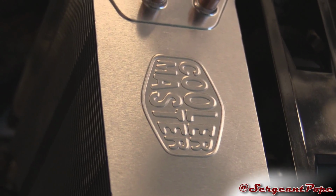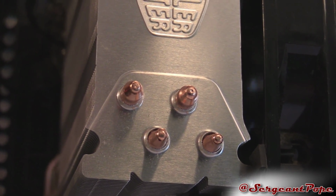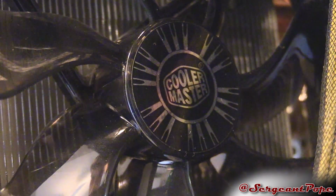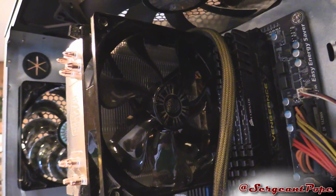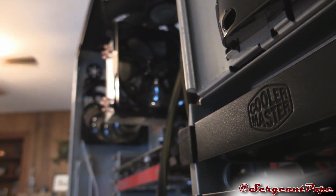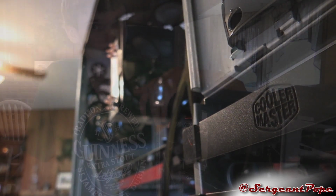Performance with the CPU cooler is honestly pretty great, and you wouldn't expect that from the price, but it just works perfectly. On this computer I have an AMD FX 8150, I think, and that's 8-core clocked at 3.6 gigahertz, with a TDP of 125 or so. So a very high TDP on this CPU, but it keeps it fairly cool. Under normal loads, it's around 40 degrees Celsius, it maxes out there. And if I'm rendering videos, doing something really CPU intensive, it'll get around 50 degrees Celsius, which is still well within the safety zone. That's pretty great with a budget CPU cooler like this.